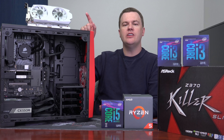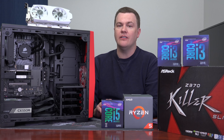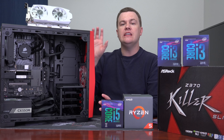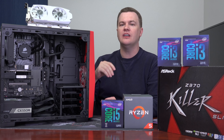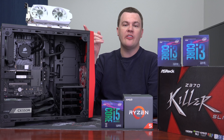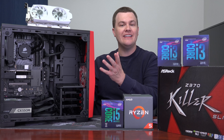You might notice the white Galaxy GTX 1050 Ti is sitting on top of the computer. Inside the computer we have an EVGA 1050 Ti. The Galaxy card is completely dead — would not power up or output a signal, and the system didn't even recognize it. I tried different cables and ports. Eventually I tried the motherboard's integrated video, which worked fine, then swapped in the EVGA card and it worked like a champ. Tried the Galaxy card in another machine — dead as a doornail. It's extremely rare for a video card to be dead out of the box, doubly so when it's a product sample from a manufacturer. Galaxy sent me that card to review and it simply doesn't work.